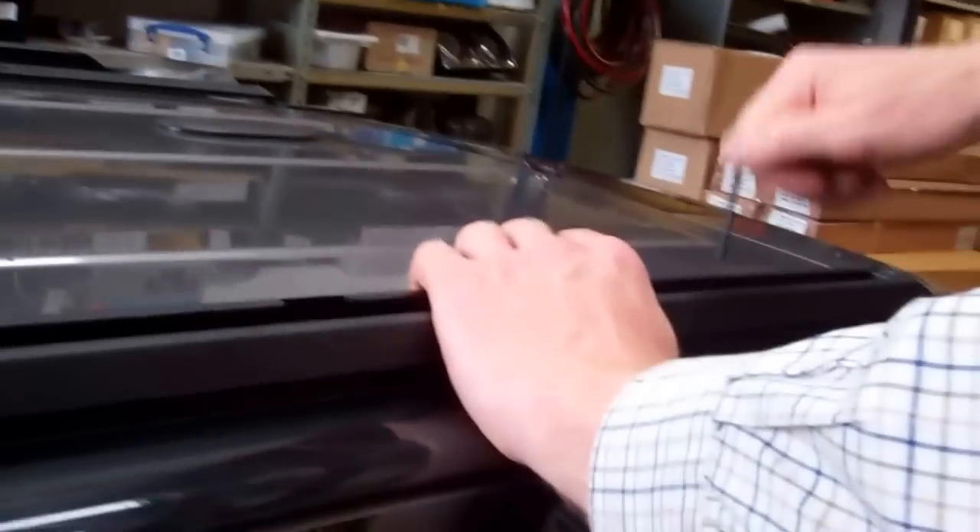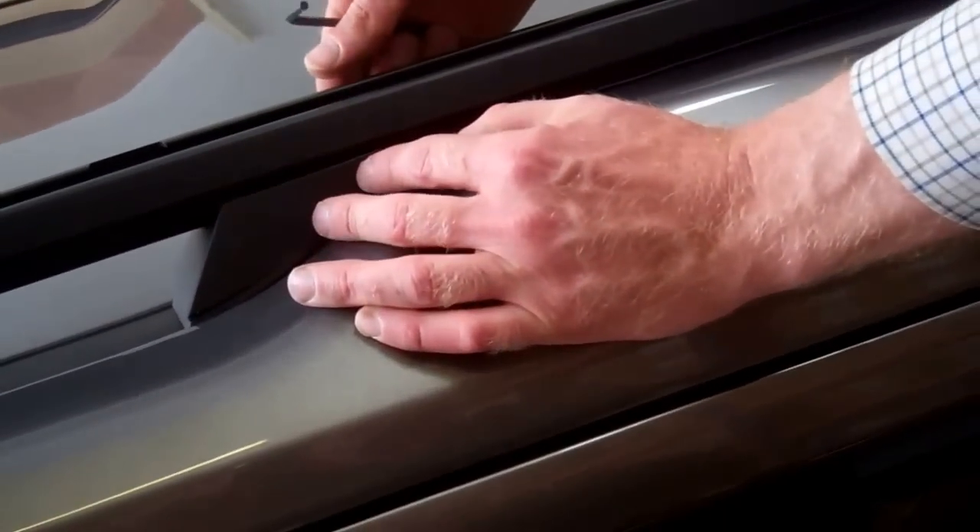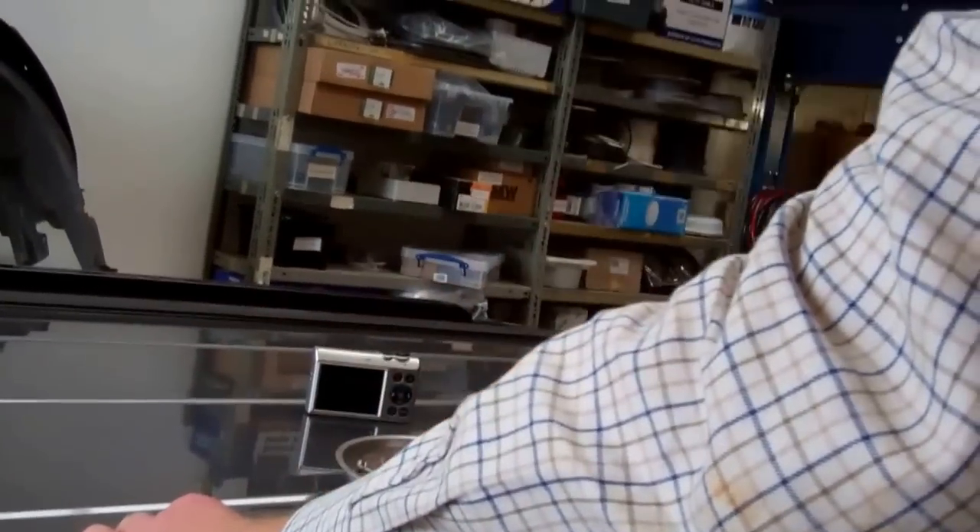They're just starting to get stiff on the lock now. You'll see here we've got a rubber channel — make sure as it goes down it sits neatly in on both sides. The other thing to watch at the front is that this rubber channel can slide backwards and forwards, so before you tighten it up make sure you push both of them all the way back so it's lined up. That will enable you, when you come to fit the front bit, to avoid any overlap.